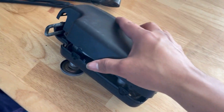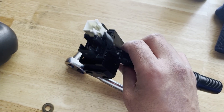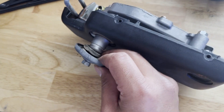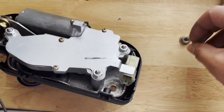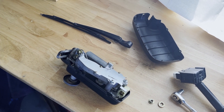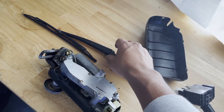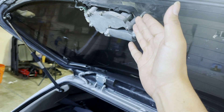For now, what I'm going to do is just clean this up. I also managed to get the wiper blade lever because I think mine might be going bad and I just want to get ahead of it just in case. Now, this install is relatively easy — it just has this one large bolt down there and the other ones are these bolts here which hold on to the lever. I've actually had my eye on trying to replace this for years, essentially since I've had the Civic, but this particular part is kind of difficult to find. I kind of do use it during the rainy season, like kind of now here in California — it would really come in handy. Hopefully this might be the video where nothing goes wrong because it's a very simple install.